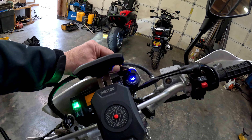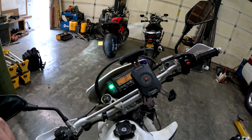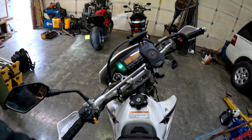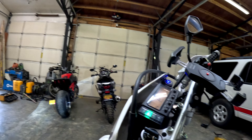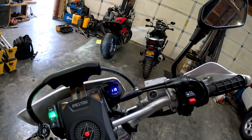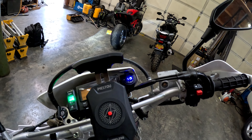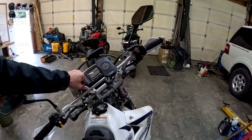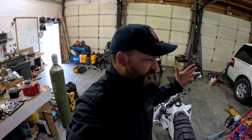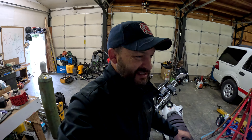Let me show you what's going on here. As we're sitting here with the motorcycle off, we're reading at about 12 volts, and that's a fully charged battery — I did put it back on the battery tender. Right after I started the DRZ, the voltage just hung out at 11.9 volts. It shouldn't be doing that. It should be rising up to the mid-13s, the 14 volts within seconds of starting it on a fully charged battery.